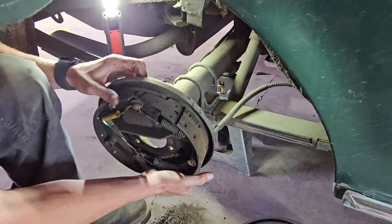These are the clips from the old brake lines — we have to bend them, take them off, and reuse them. We'll put them onto the new brake line, crimp that down, slide our new hose into the old bracket, and then put our retainer clip in to hold it in place. Now we're just going to tighten up the brake line with our clip in place. That concludes the front brake lines and now we're going to move on to the rear.